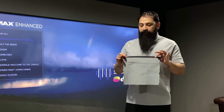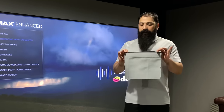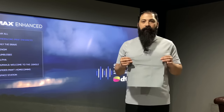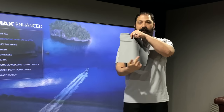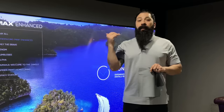ALR is different. With an ultra short throw ALR screen, it's different than a traditional ALR screen. The general consensus on how ultra short throw ALR screens are made is that they have these horizontal lines — kind of like mini blinds. So anything coming from the bottom is going to be reflected nice and even. Anything coming from the ceiling, lamps, or lights on in the house, it's going to block those.